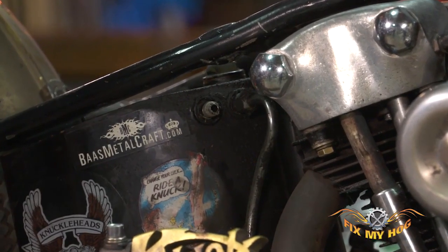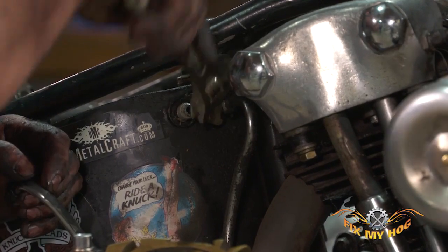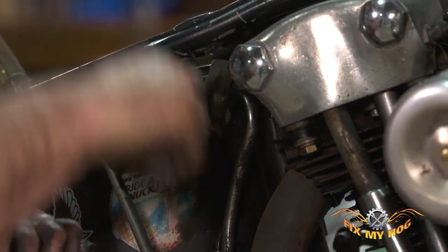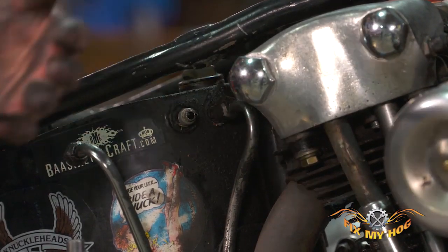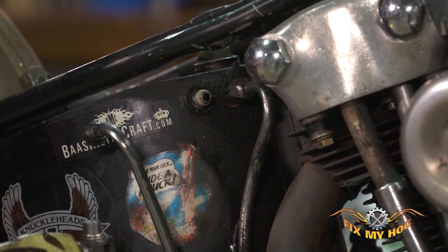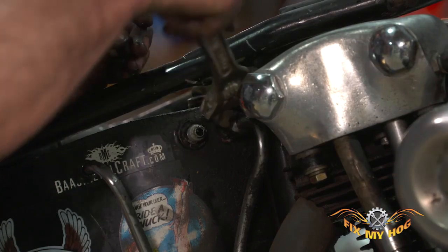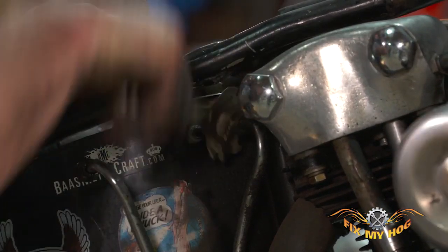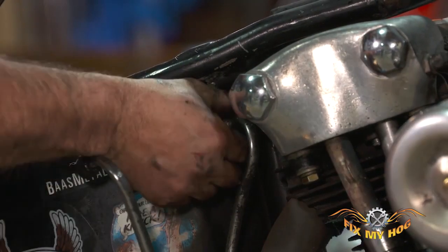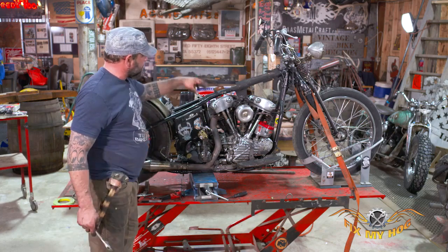The line comes off, and this one with the rubber hose I can kind of pull it down out of the way. The same is going to hold true for my oil tank itself — now that we have some compromised lines here, you can see there's actually some thread sealant on there that could get into your oil tank and cause problems. You've got to clean your oil tank out real good, get all that stuff off before you would ever reassemble this. Always put yourself in the position of doing things correctly. Sometimes the correct way takes a little bit longer, but in the long run it's the right way so you don't damage equipment and cost yourself thousands of dollars in unneeded repairs. Both oil lines are off now — I'll be able to remove my oil tank, fender, and some other key components after that.